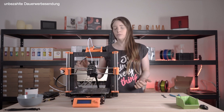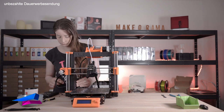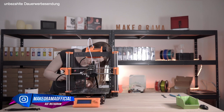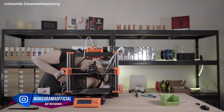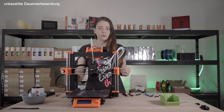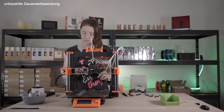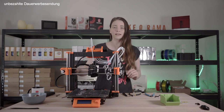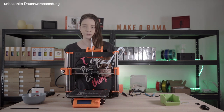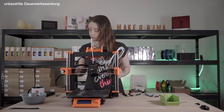The printer already looks quite finished. We just need to connect the cables to the board and build the filament buffer. I have now finished routing the cable from the MMU and reconnected the cables from the extruder — all properly connected to the mainboard, I hope. Contrary to the manual, I was able to route the MMU cable together with the main cable bundle from the extruder into the housing — so there was no need to cut the housing as the manual states. The opening was large enough.